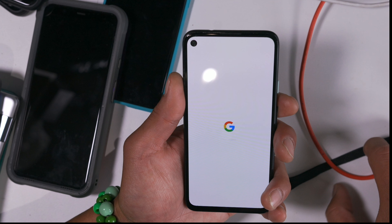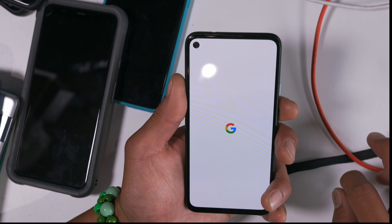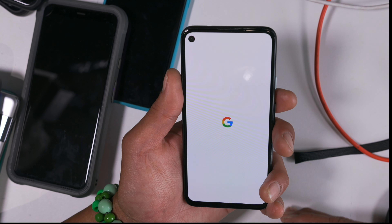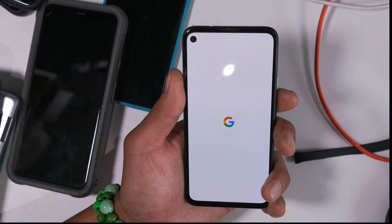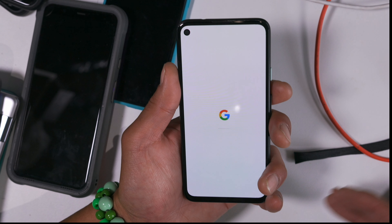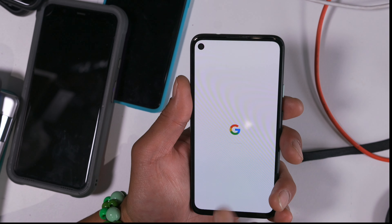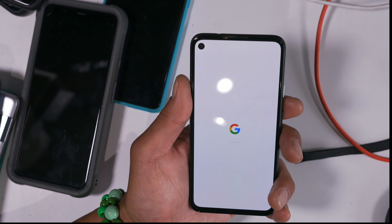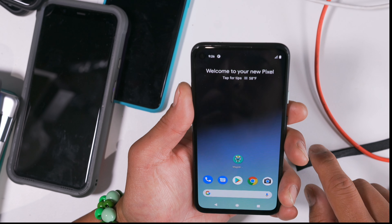Let me go ahead and verify that on my other devices. If that's true, I'll update the written tutorial. The older method without slot A and B — you couldn't do it, because the system would download the update and reboot to stock recovery. If you had TWRP recovery instead of stock recovery, that's why it couldn't update. But with the new A/B slot method, Google installs the update without actually rebooting into stock recovery, so it should work in theory — but I haven't tried it, so that's why I'm a little cautious.